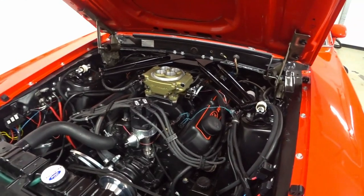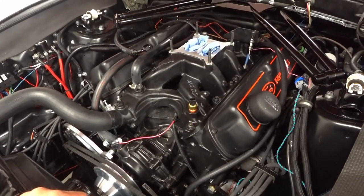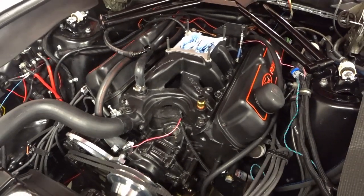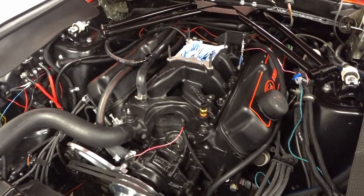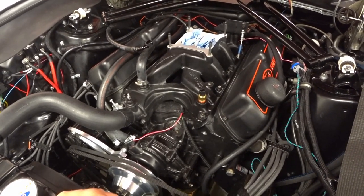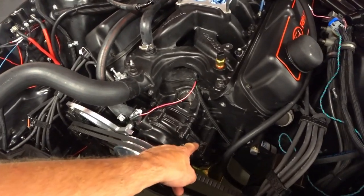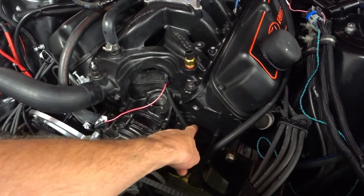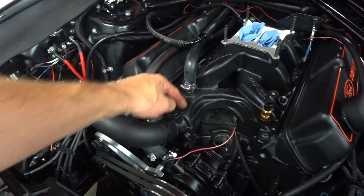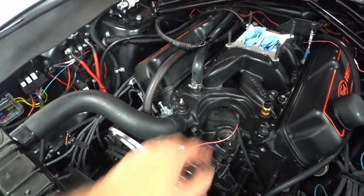So, now I begin. Well, now I ripped out the fuel injection and also the distributor is gone. And for you new in this Ford business, I can show you some tip from here. And I should explain a little bit about the cooling water. The cooling water pump sits here and pumps water in here. And the water goes through the intake manifold. And here is the thermostat housing. And water comes out and back.